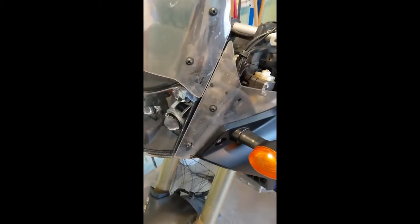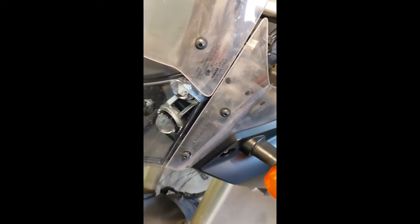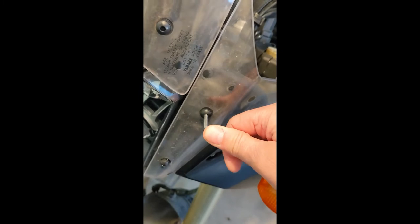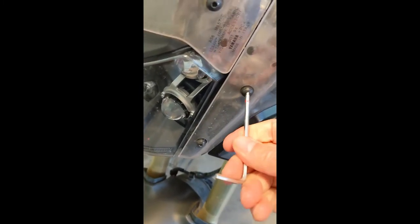I'm back — we're now at the bike. This is my Yamaha T700. The headlight grille attaches at these two bolts here and these two on the other side. In order to remove these bolts, you'll need a number four Allen wrench, and there are rubber washers behind them — you need to save those. We're going to use those to complete the installation, so don't lose those. Since I'm filming this by myself one-handed, I'll pause the video and go ahead and get those bolts out.